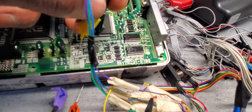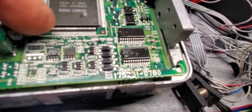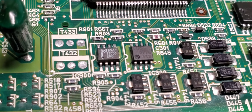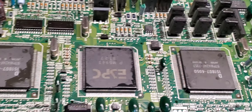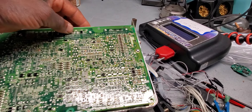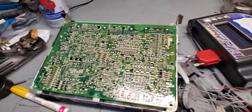On this side you have to connect all four pins, but on the other side you can connect only two — number eight and number six pin. The IC number is IC 900. You see, this is the circuit IC 900. This applies when all keys are lost. This is for all cars with an immobilizer and chip from 1998 and 1999 Lexus and Toyota — all cars that have an immobilizer chip.